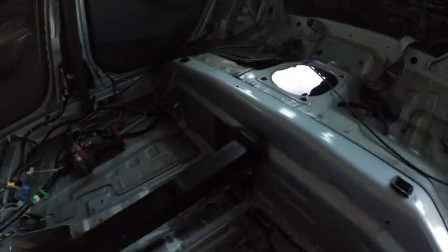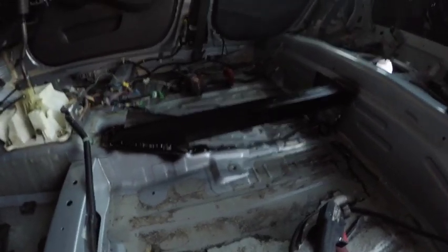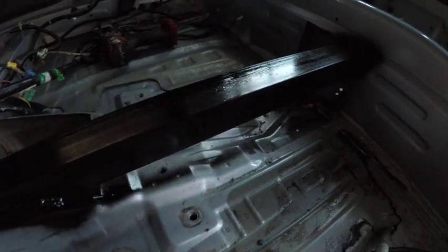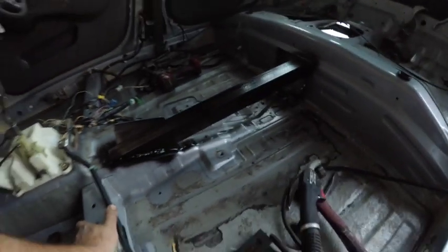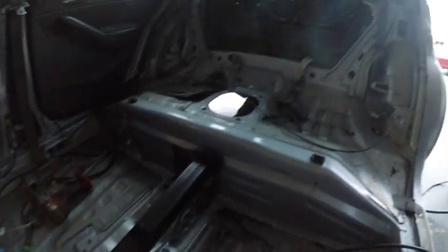That's going to be a wrap today. I had just thought about cutting this out, and then I looked at it — you can see these spot welds here, they actually go to a little chassis that's two separate sections, a chassis that runs through the middle beside the big rails. So I decided to make a brace. It's angled, a bit overkill, but I had to make up the strength I'm going to take out of this floor, which is double-layered there and double-layered over there. I've already welded that in. Driveshaft is next — got to get this floor out first. Diff's already mounted.